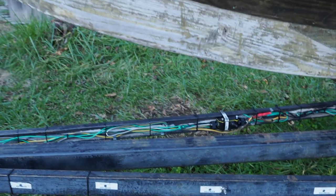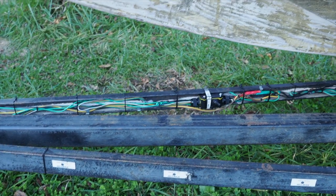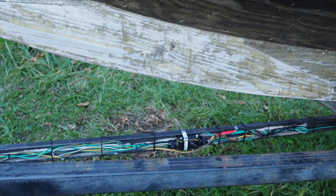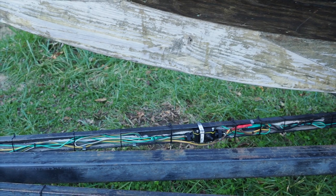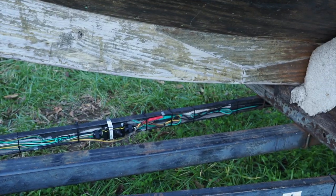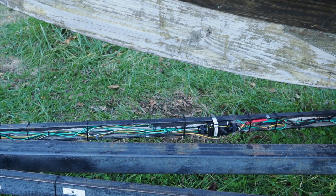You may be wondering why there are so many wires here. There are three reasons. One is I didn't trust the trailer frame for ground, so there's this ground wire. The second is I didn't have any splices far back under the trailer, so everything is spliced together here. You'll notice some of the slack is taken up in extra loops.